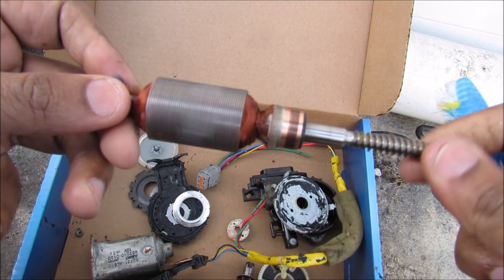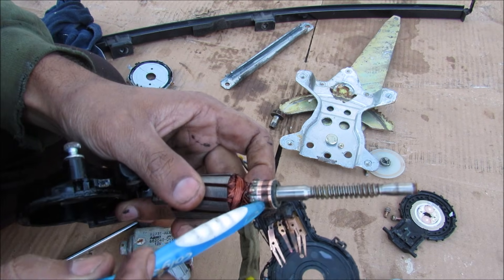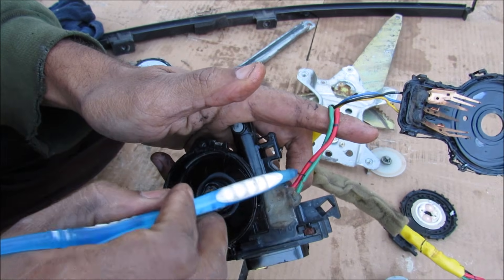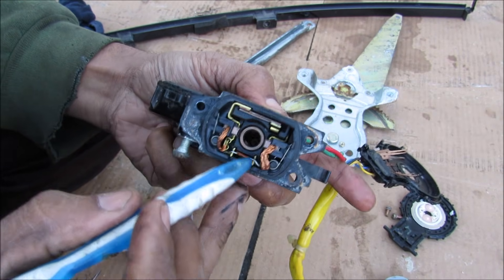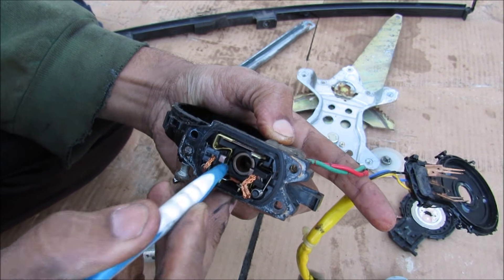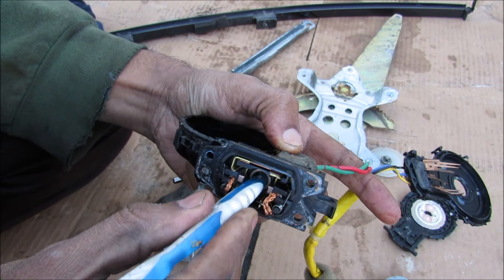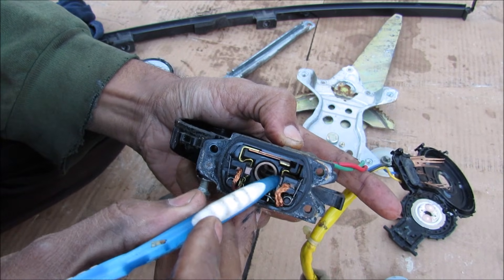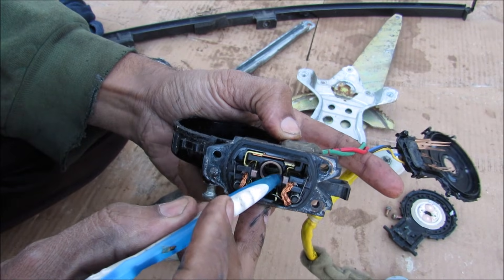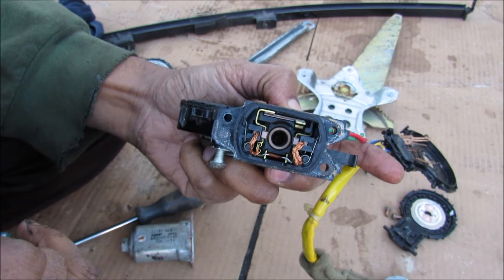This motor is actually balanced by gouging out pieces in the armature so it's balanced with the other side — that way when it rotates, it doesn't vibrate. We've got the commutator over here where the brushes sit right up against. Following the two power wires inside of the housing you'll see two brushes that are spring-loaded and sit inside of the middle of where the shaft rotates. These are probably the highest wear points in any electric motor, so if your motor doesn't work you probably need to replace the brushes because they're just worn out.